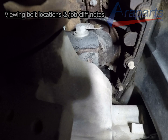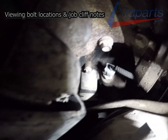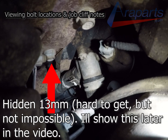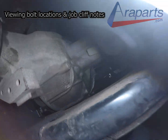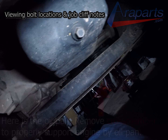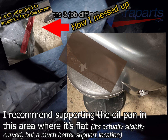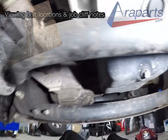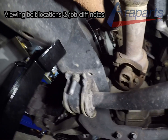Watch for that hidden bolt behind the left-hand engine mount plate. You really have to stick your camera up to see it — you can't see this bolt before the engine gets lifted. It's really hard to see, but once you lift that engine up you can get that bolt out. The crossmember has to come out, and you'll see how I messed up: I tried to lift the engine without removing the crossmember and it caught the very corner of the oil pan — you can make fun of me in the comments, but lesson learned.